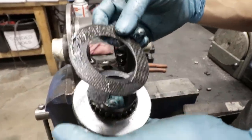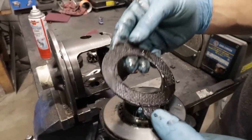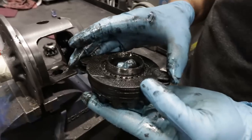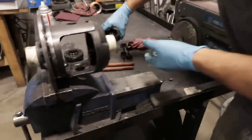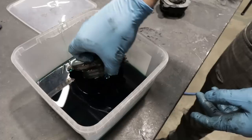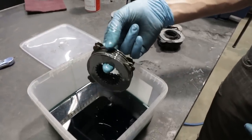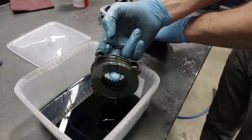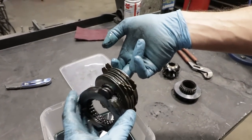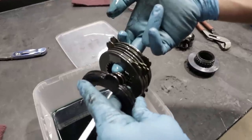We pull out one of the old clutch packs. These actually don't look to be in bad shape — looks like they've still got some material on them. Typically these wear out pretty fast on cars driven hard, but I get the feeling ours was like a highway cruiser. Here's our Ford Performance clutch pack that we've been soaking in friction modifier for a full day — good God, does it stink. But this is part of the process for rebuilding the diff; it prevents any chattering. We line everything up, split the pack in half, put it on the opposing sides, and get the diff back together.